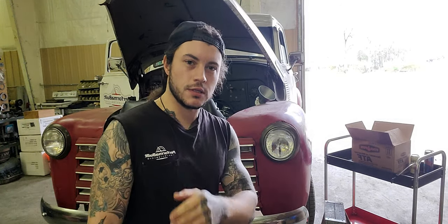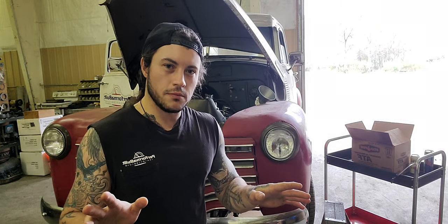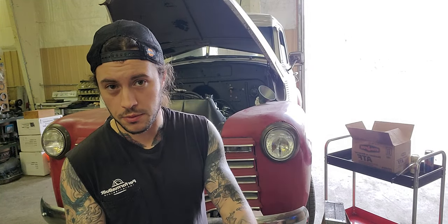The moment you slap a 6 liter and a deeper pan on it and change all this other stuff, okay, just going back to transmission modification. 2000 Camaros, just as an example, this applies to Silverados and everything else. Everybody's hot rodding nowadays. 2000 Camaros, namely F-bodies, usually had a shallow pan, okay? And GM has put in place a certain amount of line length and a certain transmission cooler in the radiator and a certain size torque converter. I believe it's 12 inches, it may be 11. I'm not sure. It's not that big of a difference.